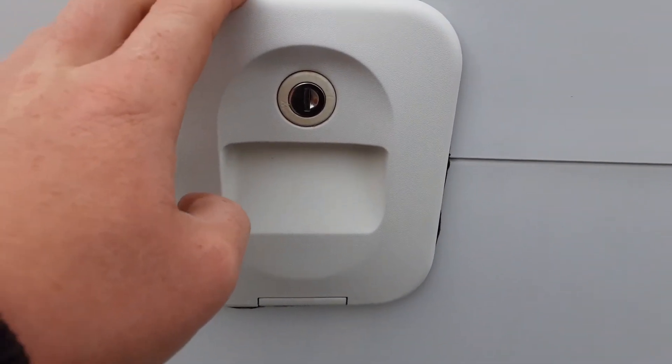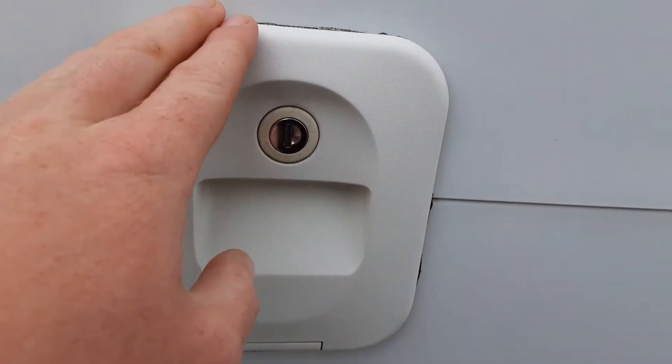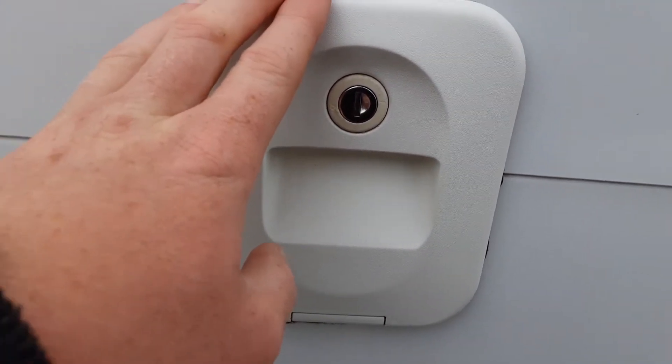You've got your toilet flush tank — it takes three and a half litres of water, so you'll undo it with the key. Put three and a half litres of water in here and a capful of the pink fluid prior to use.